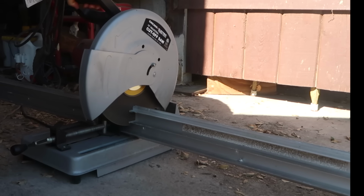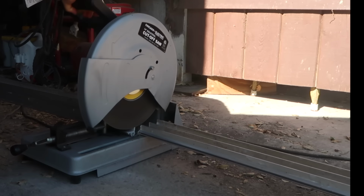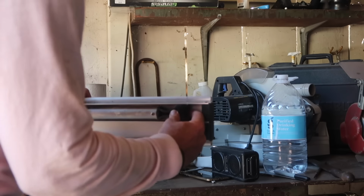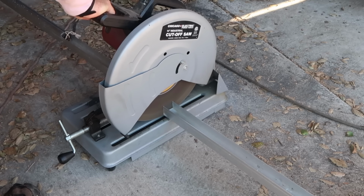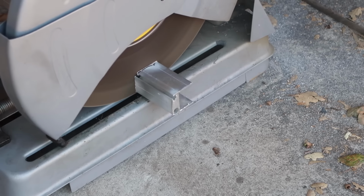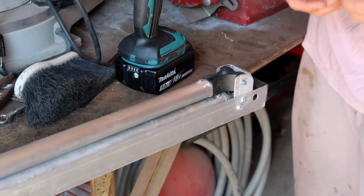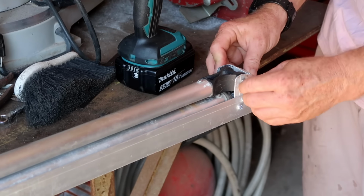Next, I shortened the aluminum extrusion that mounts the awning onto the camper and holds the awning arms. New mounting holes were drilled, and the awning arms and end caps were reinstalled. Next, I shortened the aluminum extrusion that attaches the canvas to the awning legs. I cut a small piece of the excess material to fabricate a bracket that allows the legs to fold into a stacked orientation so that both legs can fold up along the shortened extrusion.